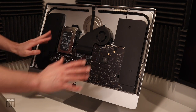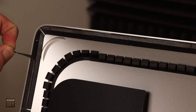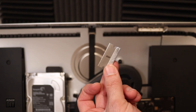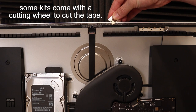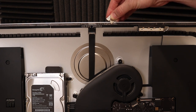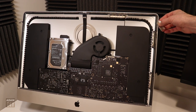You break the glass, you broke everything — you have to replace it. It's a little unforgiving, so you want to be careful on this part. This is what we're going to be cutting through to get the monitor off. You'll find that this style of razor blade is much superior to the other one, only because it's a lot thinner — so you're going to be able to get it in between the glass. If you measure in, it's going to be 5/16ths deep, just over a quarter of an inch, about eight millimeters. I started in the corner, lifted it up just a little bit with my fingernails, and ran the tape to the middle.